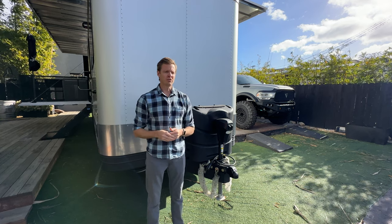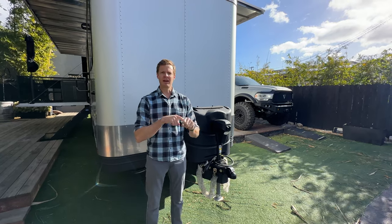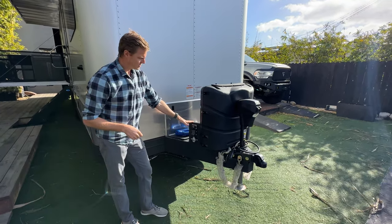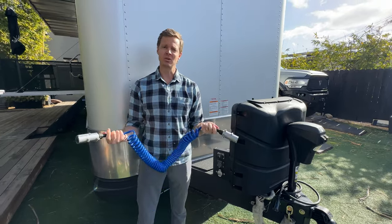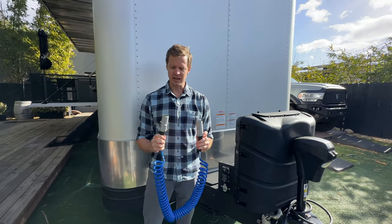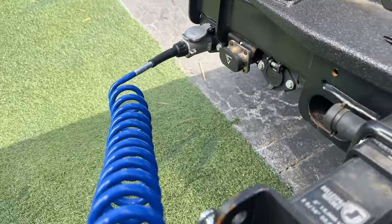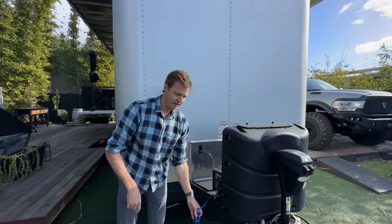This can also be installed on late model vehicles. Ford, Ram, and others offer a standard connection port where you can plug that video feed in and have it viewable on the dashboard, fully integrated into the truck itself. The video feed is included here at the A-frame. This is the custom installed power tower, and we have this bottom port right here. This is a commercial grade connector cable, and there's a reason we install a hard line — because wireless video feeds tend to fail. You just connect this here, and the other end connects into the bumper of the tow vehicle.